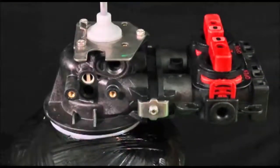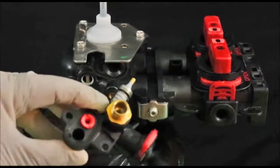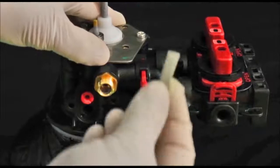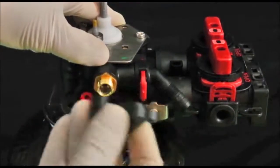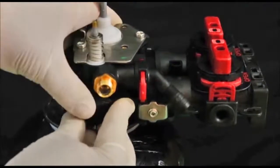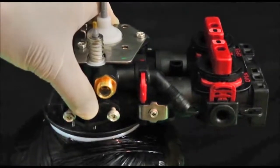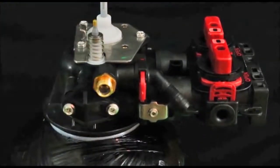Now that we've replaced our throat and nozzle of our injector, just pop it back in, making sure all O-rings are still there. Slide it up. Injector screen. Make sure the O-ring is still on the injector cap — see how it's got one high side, so you can't get it wrong. Pop that into place. Your 5/16th bolts — use the handy electric drill. That's the injector assembly on a 6-5 control.